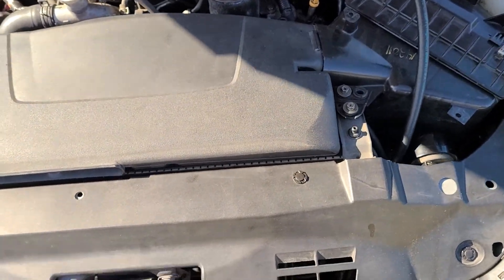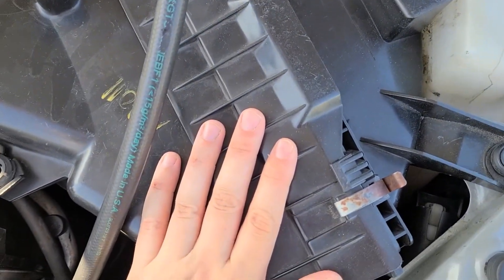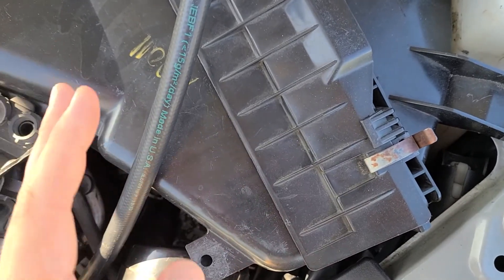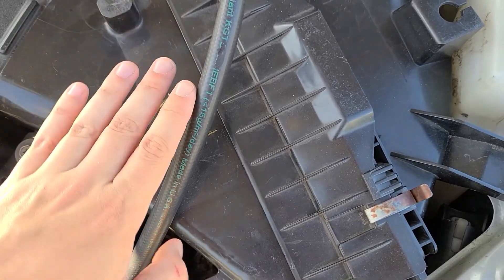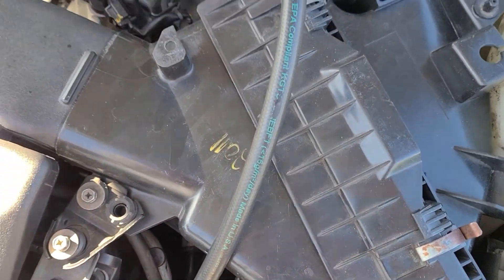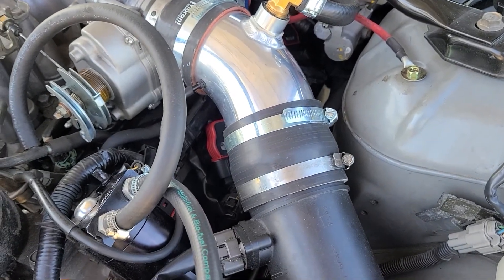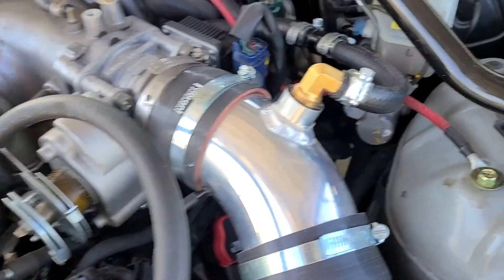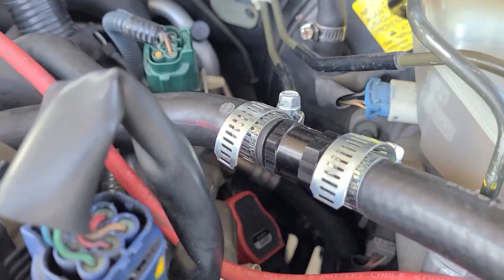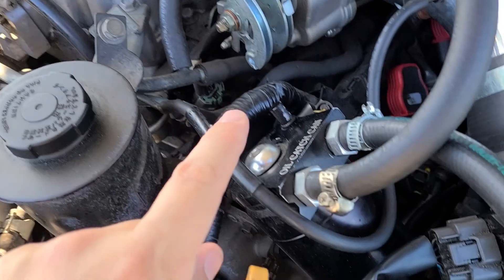There have been many revisions of the intake, but this is the current one. It's a stock intake with a K&N drop-in. It's completely gutted — the whole air box is basically flat, almost paper thin at some points — and I've actually taken an epoxy and poured it in, so it's really, really smooth. The idea was to mimic a GTR air box, which is very similar in design. I've got the intake elbow replaced with intercooler piping. The stock PCV has been deleted and this is our breather — it's got a one-way check valve so it can only feed cold air into the crankcase, and then the PCV side flows into this catch can.